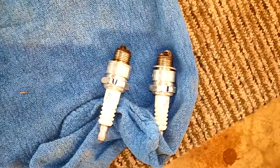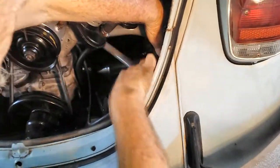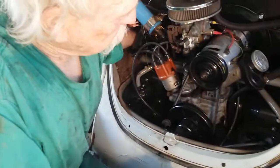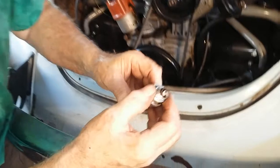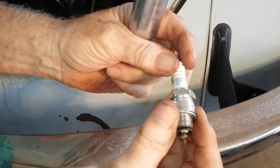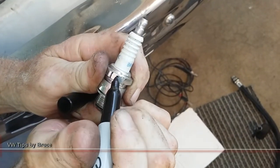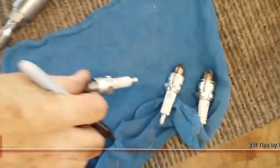We'll lay that right next to number one and we'll do this with three and four. All your plugs will be pulled out. This could be a brand new short block — it does have case savers. We got number three here, we're going to mark that. This is usually the suspect one in the old days. Oh, that's looking real nice. Brand new plugs — NGK. They're acceptable. We'll mark this one.